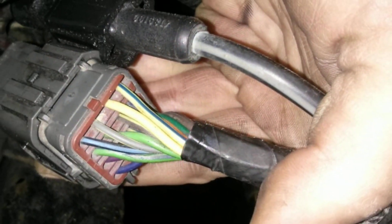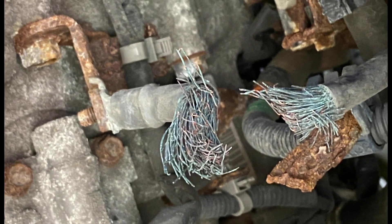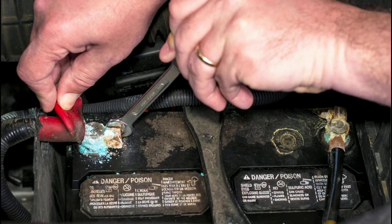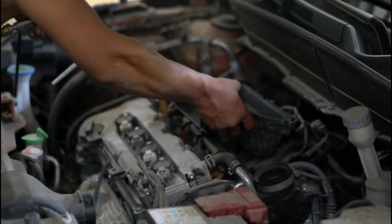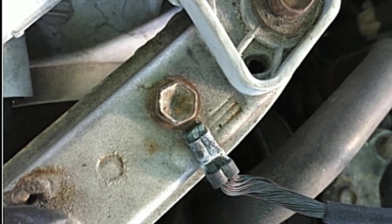Two: check the connector and make sure that all of the pins and wiring are in good shape, then thoroughly clean both the plug and the connector. Sometimes, while wires are not broken, grounding lugs may cause this issue. You will notice up to six grounds near the connector — take each of those grounds off, clean them thoroughly, then spray them down with some battery terminal protectant before reinstalling. Sometimes the problem is caused by corrosion in the grounds, and a simple cleaning will save you the expense.